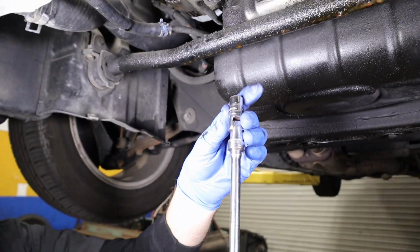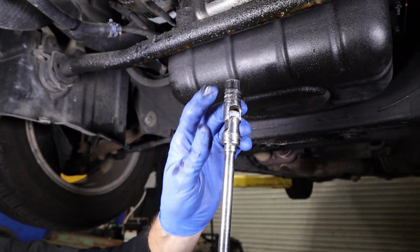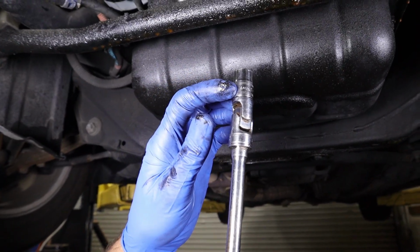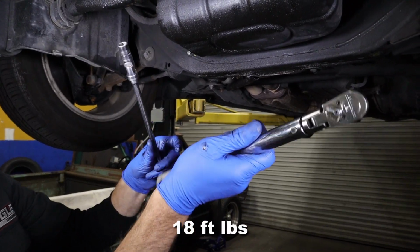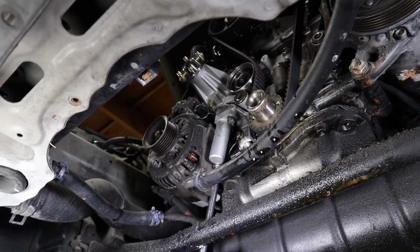As I said previously that you could fit a 3/8 in there, so I have a 3/8. This is just a wobbly, it's not a wobbly socket, it's just a wobbly. It's non-impact, it's a chrome with a 12 millimeter socket on it, and then a 3/8 extension. Then I have the torque wrench. I have it set at 18 foot-pounds, so I'm going to take the 3/8 socket, go up here, same way. You can fit it up in here, no problem, just like I mentioned.